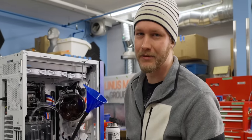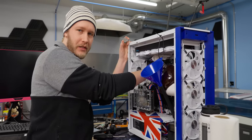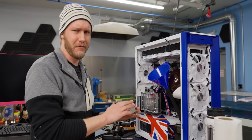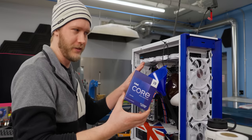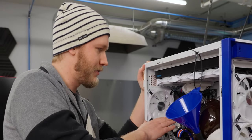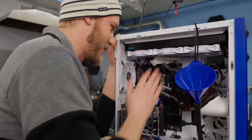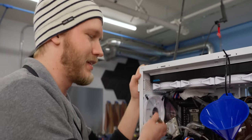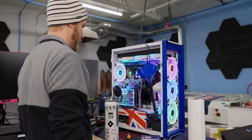For whatever reason, RAM will only work in the first two slots — the A channel — and it only boots in slow mode. I was having a bit of issues with this motherboard and CPU beforehand, but I was able to downclock the RAM a bit and it was fine. Now it's just not working at all. To solve it, I grabbed a 13900KF we had sitting around for a different build. Maybe this is the Spiffing Brit's new CPU if this goes in and just works. I have removed all the Vaseline and checked all the pins. I'm guessing something was wrong with just the memory controller and how it was mounted slightly differently with this CPU cooler was enough to knock her off kilter. Well, here's where we find out if things are bad or catastrophic.